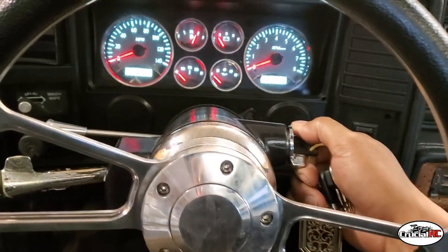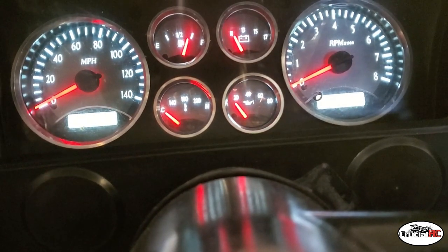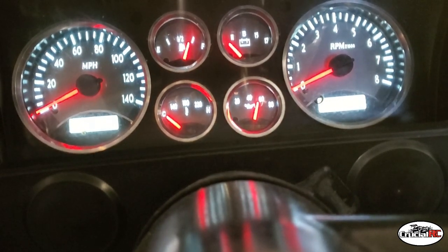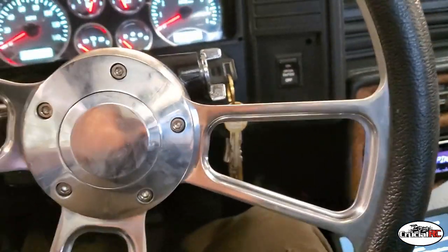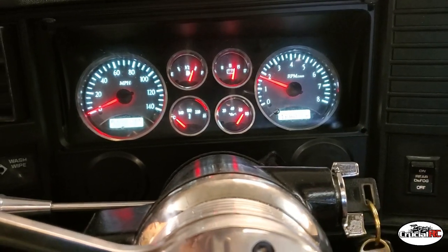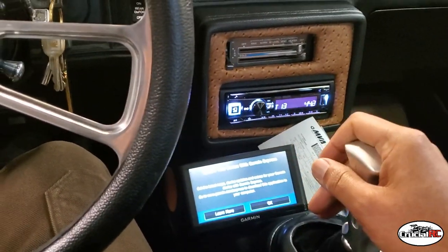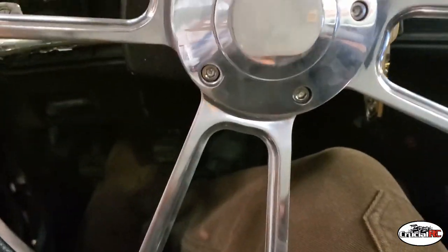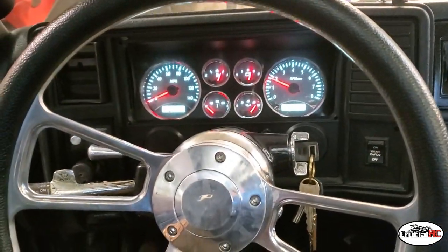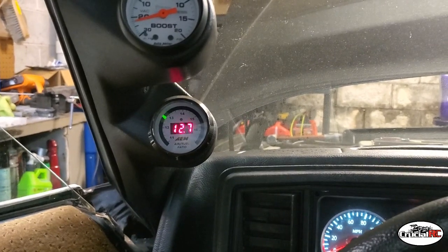All right, let's see what we get here. Getting that oil pressure up — I'm sitting for like five minutes, not even hitting the gas. All right, we got the oil pressure up, hit the gas a couple times — carburetor was empty. Right up, baby, that's what I'm talking about! So we changed the jets on the primaries from 68s down to 66s, trying to get the air/fuel ratio right — that's why it's idling nicely, not smoking us out.